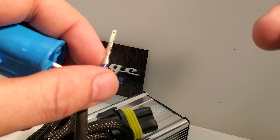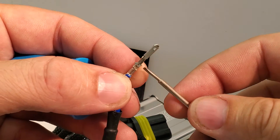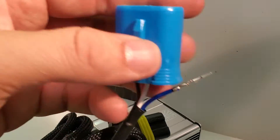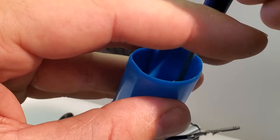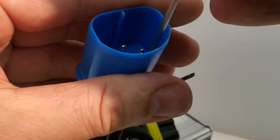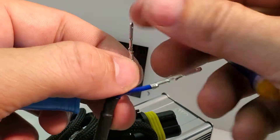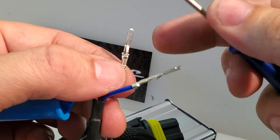It's kind of a two-handed operation — pushing down on the pin while pulling it out. Keep in mind you're not done though. You can't just push this back in because the retaining clip, if you push down hard, will stay down. You want to pull that back up. Do the same thing on the other side and if you push correctly it will flip right out. Never forget to flip this pin clip back up — this is a problem because pins will push out otherwise.